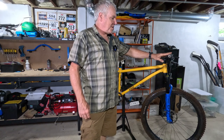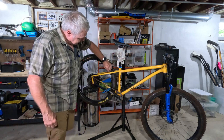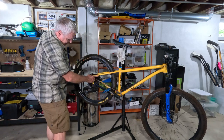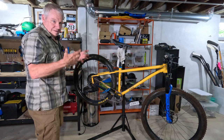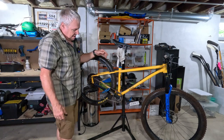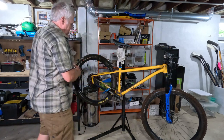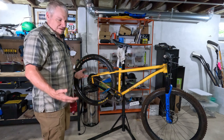Hopefully it's pretty seamless. I should be able to take the shifter off, undo these bolts, and I have zip ties here — I want to get those little clamps but I can't find any. I'll clip off the zip ties, take the derailleur off, and the whole thing should come off as one unit. Then I just have to take the cassette off, put it aside, throw my single speed cog on, and swap back to my blue chain ring. Once I make that switch, this thing's ready to go as a single speed.